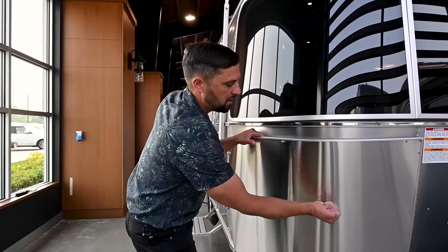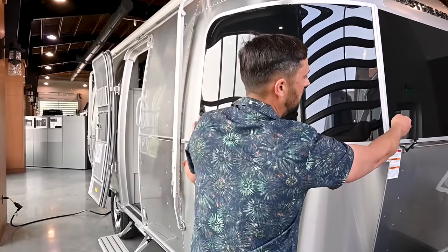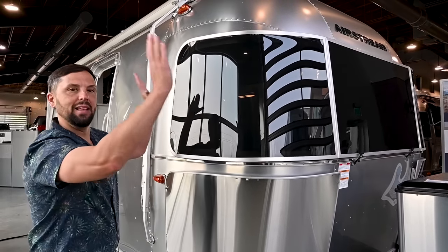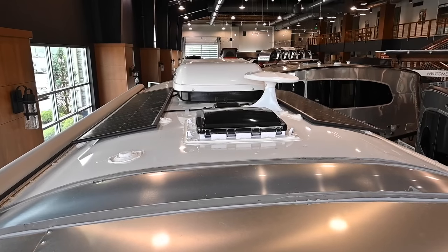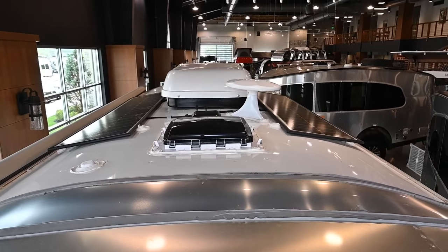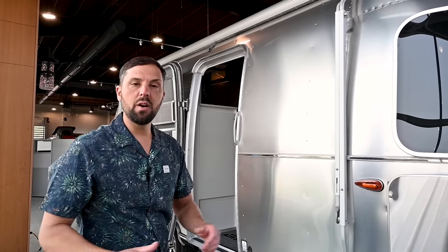The stone guards are more resilient than the aluminum body behind them and gapped to allow deflection so they don't dent the body. They're also removable — lift the panel, take a screwdriver, quarter turn, swing out and lift off to clean your glass. Up top, this has the optional 200-watt solar charging system. There are two MaxAir fans in the ceiling, a bathroom fan, and Airstream utilizes the remaining roof space to offer optional solar.